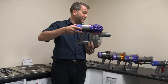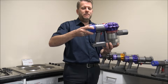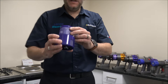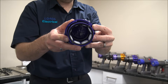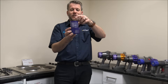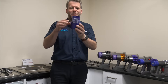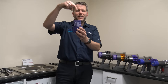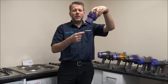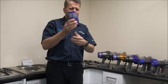On the V6, V7, and V8, on certain models depending on which one you go for, you have a filter on the back as well. As you go to the V10, the filter on here is slightly different — it's an all-in-one filter, so you only have one filter on this model. There is a picture of a tap on it, recommending to wash it that way around. Personally, I'm not really sure about that — if it's dirty around here, washing all the dirt into the bottom doesn't feel right to me. I'd prefer to try washing it either sideways or even upside down, because then it's releasing all the dirt and dust rather than just sitting in the bottom.